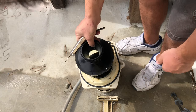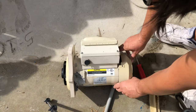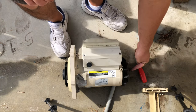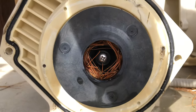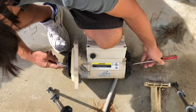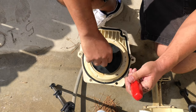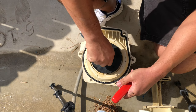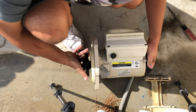We'll remove the three screws that hold the back cover plate on. There's a slot back here for a screwdriver and a Phillips head over here. Holding back the shaft with one screwdriver, we remove the screw from the front of the impeller, and now we unscrew and remove the pump impeller.